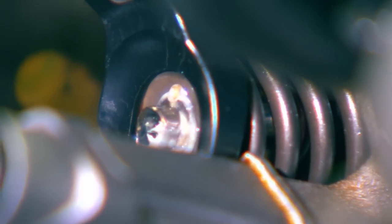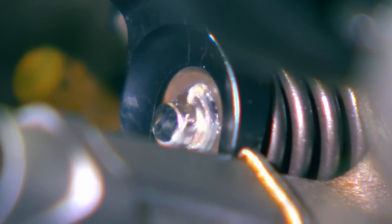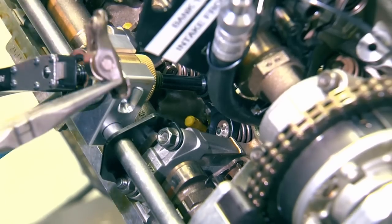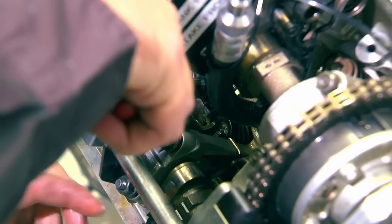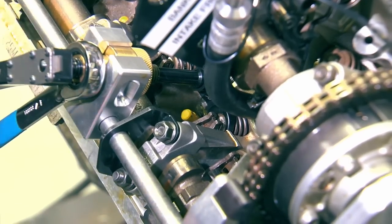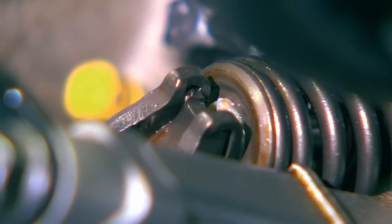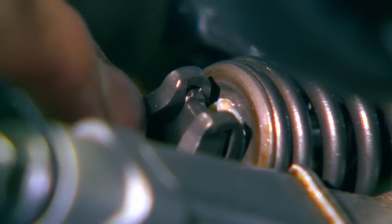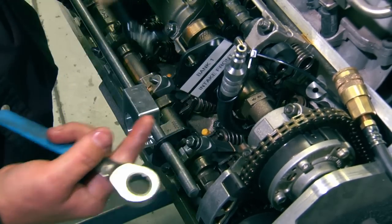Now release the compressed air in the cylinder and re-compress the spring so you can install the rocker arm. If the spring stays, just push it down by hand one or two times. You can install the rocker arm by hand — I find that easier, though I'm using pliers here so you can see what I'm doing. You can feel the rocker arm snap onto the lifter. Once it is on, make sure the rocker arm is fully seated on top of the lifter and on top of the valve. These simple steps complete the replacement of the valve stem seals.